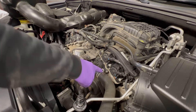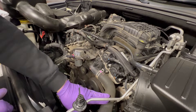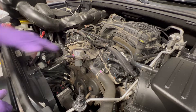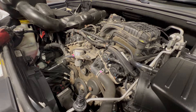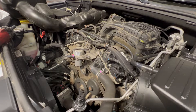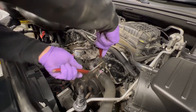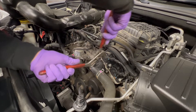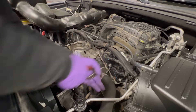All right, I want to tackle that hose right now. The thermostat's in here, so if you've been driving this thing, it's hot — the fluid's hot. You might want to crack the rear radiator cap — that's going to let it flow a lot faster. It's going to open up a funnel and flow faster. We're not going that route — we're going to remove this clamp now, just bring it back a little bit.